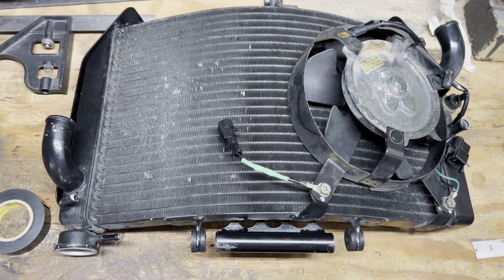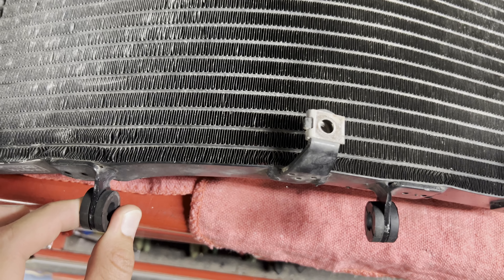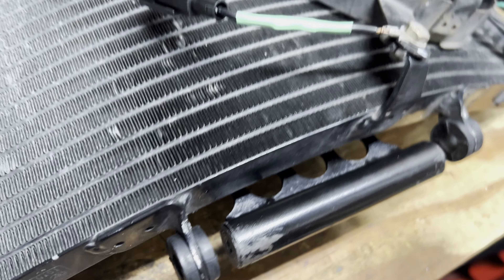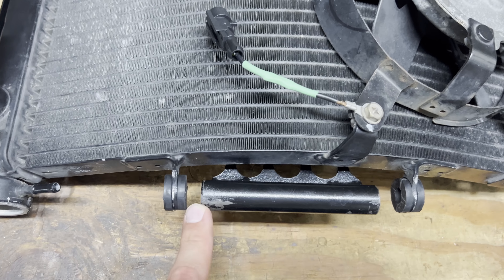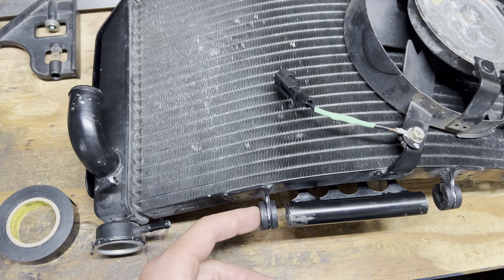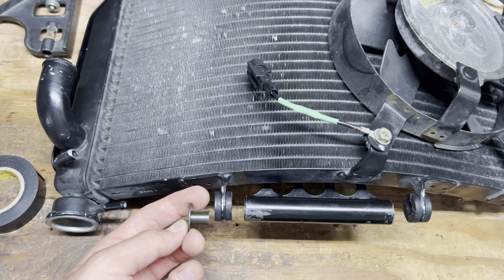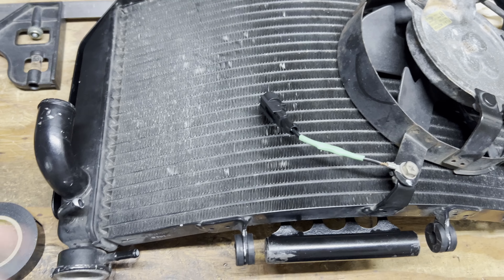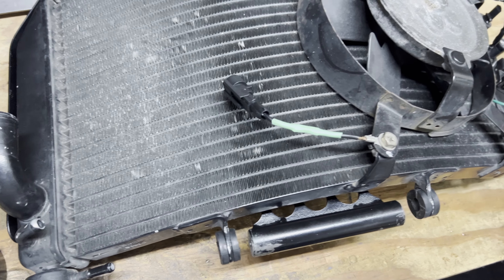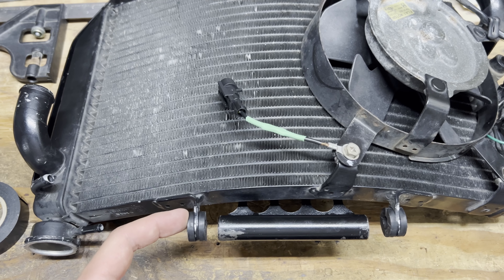I got it on eBay, an OEM one. The only reason I did this was to find one with tabs that align better to this part of the cage. The old one on the right was kind of bent out of place - the radiator was pulled up and never aligned into the cage properly. There are threaded holes here and here; I could get one side in fine but the other would never align. Now they're a lot straighter. I also took out the bushings that were normally in these rubber gaskets. The reason is you can't get the fitment perfect and you end up cross-threading these threads. The diameter of the bushing is a lot tighter than the diameter of the tabs on the radiator.